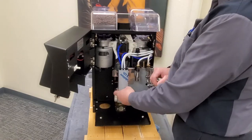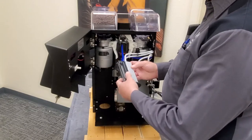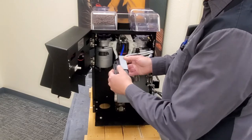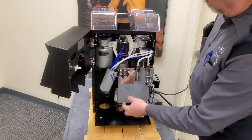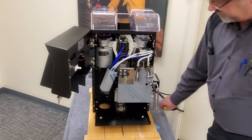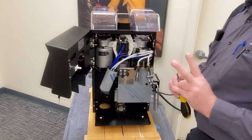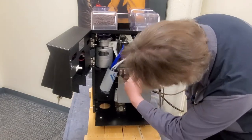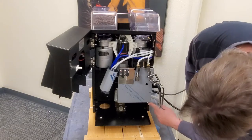You can see the upper piston here — this will slide right out and you can completely disassemble this. But to get at the rest of the brew unit, we're going to need to remove this panel right here. It is three screws: two screws you just need to loosen — there's this one, one right behind here — and then the third one we're going to remove is over here.